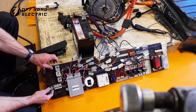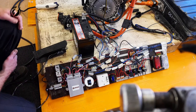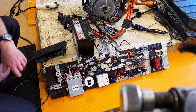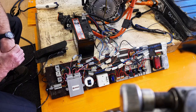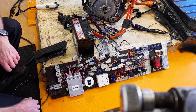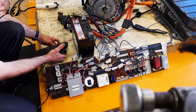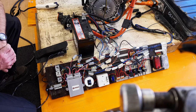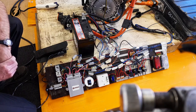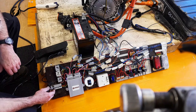If I operate the brake pedal and push the forward unit again, you'll see the bar comes up here giving me regeneration to a smaller degree. You'll see it brings the motor to a fairly rapid stop and also introduces the brake pedal as it's decelerating. And if we do that again, we get a higher degree of regeneration which will stop it even quicker. As you can see there, you wouldn't expect to get the reverse motion once you're in the car of course. The gearbox has been removed temporarily so we can remove the parking brake unit inside it, but while it was off we decided to run up the motor.